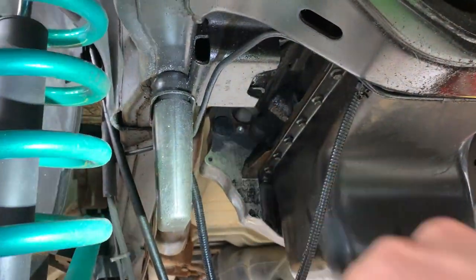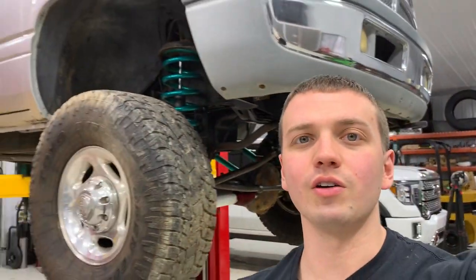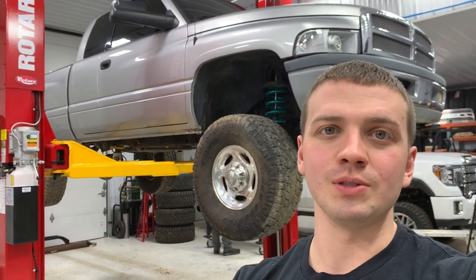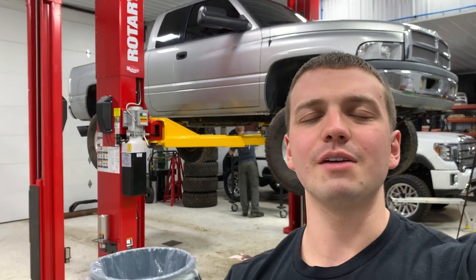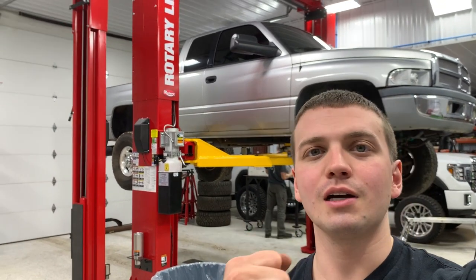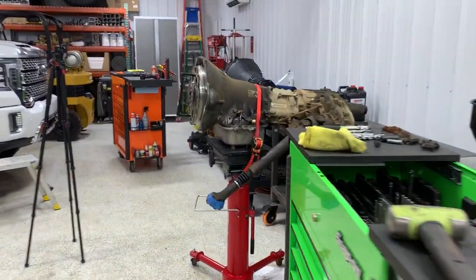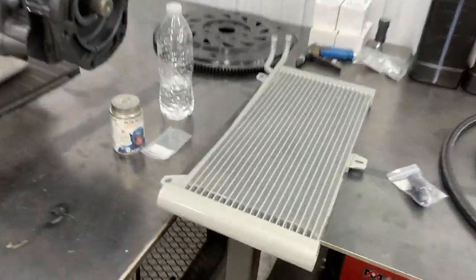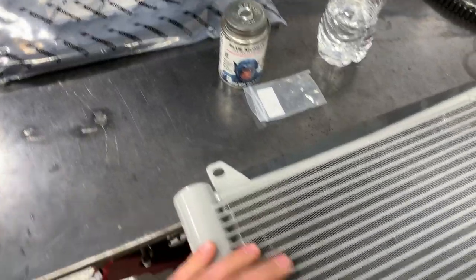Cooler lines — here's one of the brackets that ran down the front and connected to the cooler. When doing a new transmission, especially from one that failed, it is not an option to skip a new cooler — you have to do it. All the clutch material from the converter and clutches builds up in those fins. That's the smallest point, so it acts like a filter. Put a fresh trans in with new fluid and you're recirculating all the debris stuck in that cooler. This is a perfect time to upgrade to a Mishimoto cooler, especially if the truck is going to be towing.